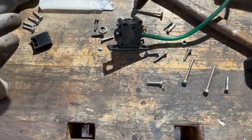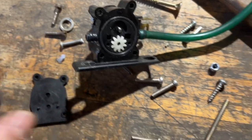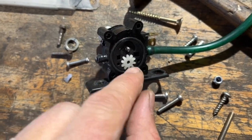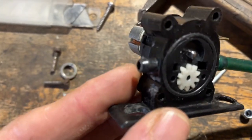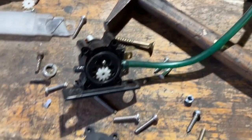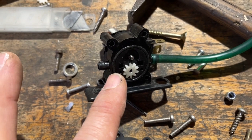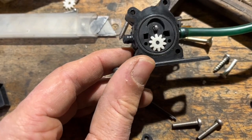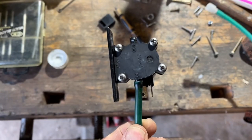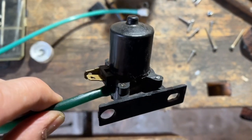Just to give you a catch up on what I'm doing - I'm pretty sure that the issue here is this O-ring has seen better days, possibly slightly deformed over the years, and there's not enough sealant here. Also through this hole where the motor goes through. So what I've done is found some screws which fit perfectly into those holes, and I'm going to run a very thin bead of sealant around that O-ring because I haven't got another one. I'm also going to put some grease in the hole with the motor spindle so that hopefully that will block that slightly and we'll get better suction. That is the pump sealed, reassembled, and I'm now going to fit it into the car and see if it works.